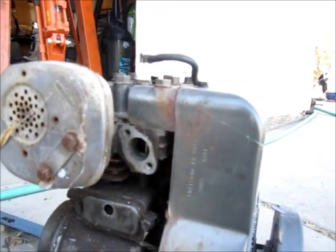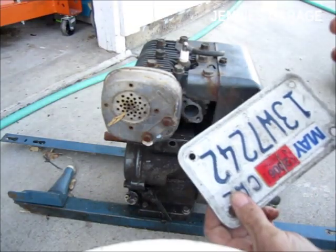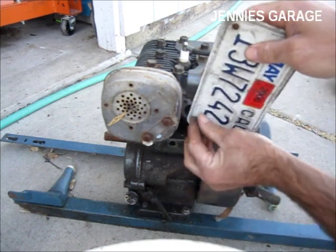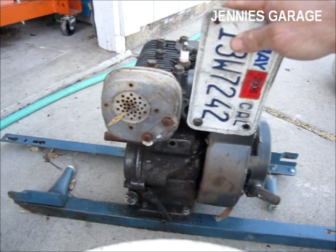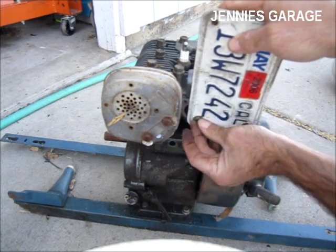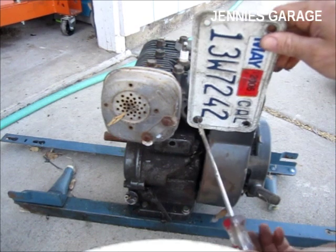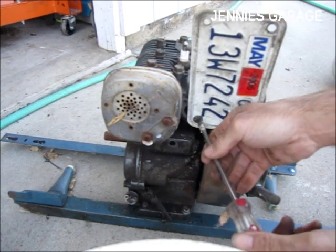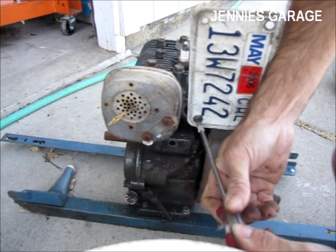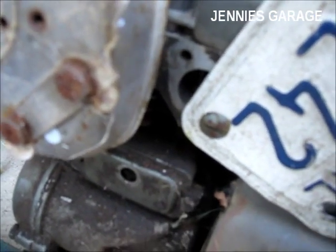So what I'm going to do is make a highly engineered throttle plate to put there. Here's my throttle plate — it was, of course, specifically manufactured for this application. I'll just put this screw in here, and this will restrict the airflow enough that when it runs it will lope along at a nice steady pace rather than just going crazy and causing a lot of havoc. I'll tighten this screw down and close off the throttle opening quite a bit, and if I want to adjust it I can too — that's the beauty of this mechanism.